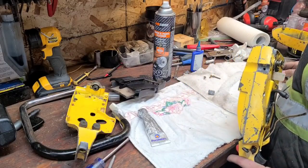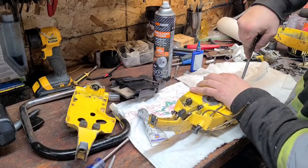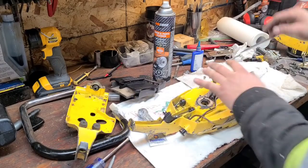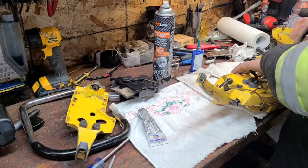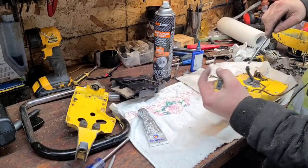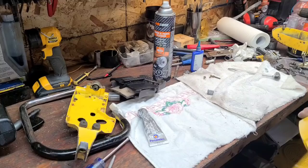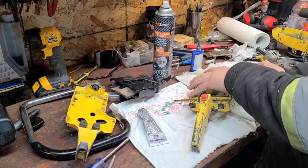Good. Our Moto Seal is oozing out. Just reef this down like we normally do. Nice and tight. Checking that there's Moto Seal oozing out. There is, so not a ton though, and like I said, the mating surfaces of this tank are super rough. So hopefully this gasket is enough to seal it up. If it isn't, we'll have to go back and figure out another way. And in fact, this gasket's in there nice and tight.